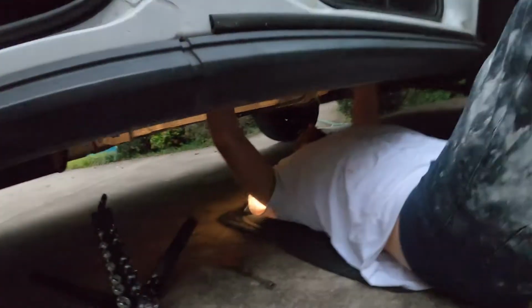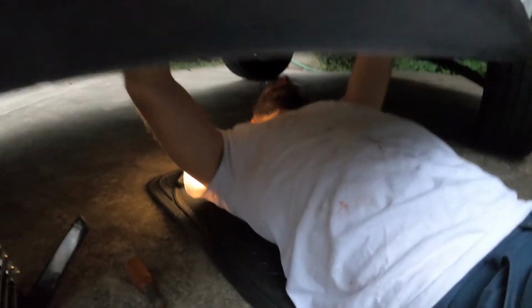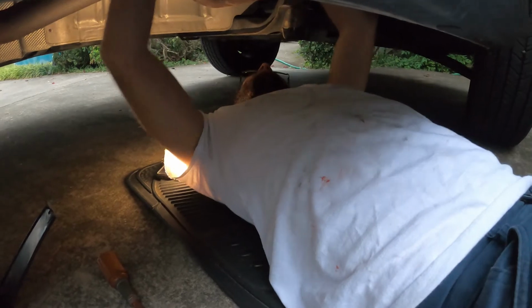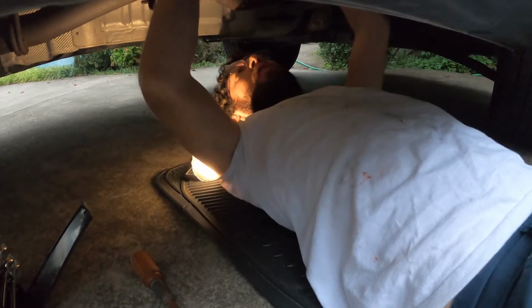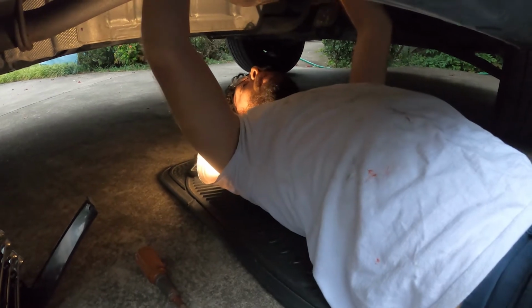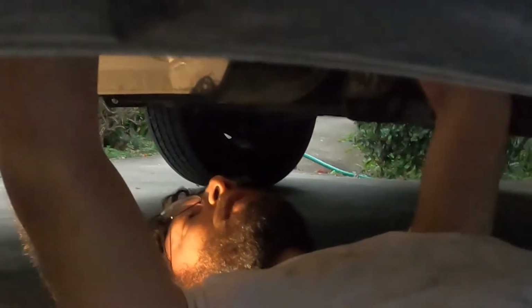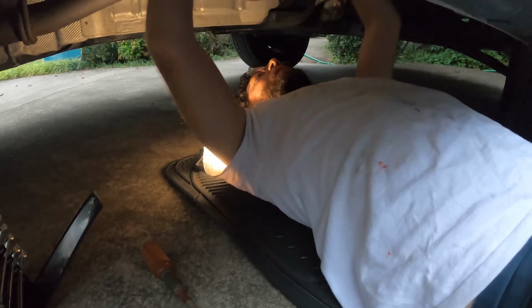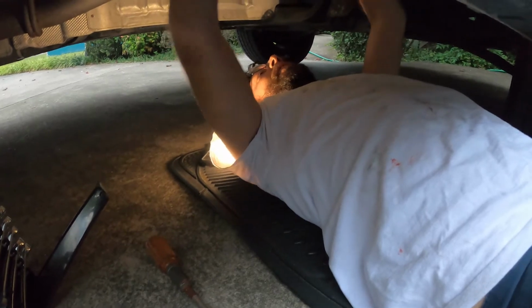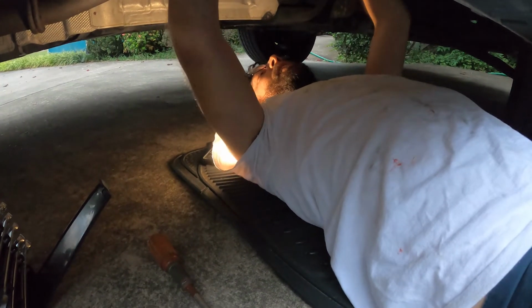Right, and also we put a flat doubler underneath the Webasto heater, so it made the surface flatter. And we also use silicone to secure and cover all the holes because you don't want any gas from outside to come inside. So we use silicone to do that. Currently it should be super safe inside with all this silicone around it and rubber gaskets.